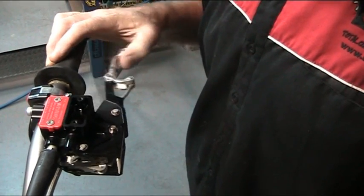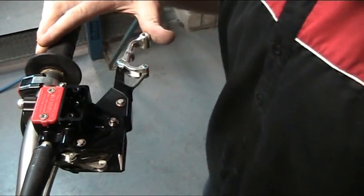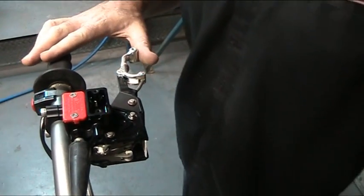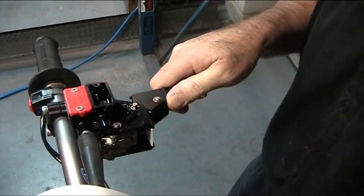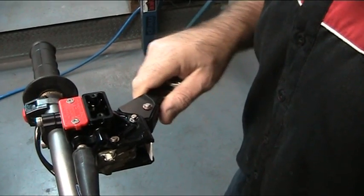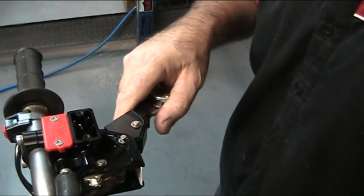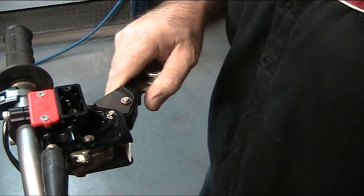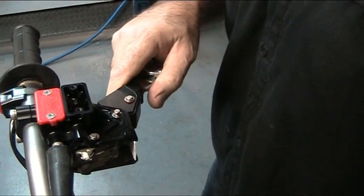With the bleeder shut, we're now going to close off the bleeding valve, pull the brake lever in and see if we've got any brake pressure — which we haven't at this stage. What I do is angle the handlebars down on the left hand side so that they're lower than the right hand side. Then fold the lever outwards, and again two clicks to get the brake arm off, and then push that back in. You can see the air bubbles coming out — it's just air trapped in the top of the cylinder. Just keep repeating that until you can no longer see any air being forced upwards.